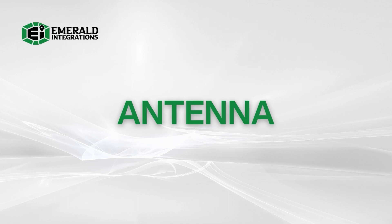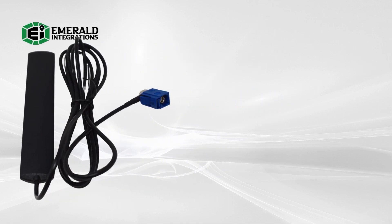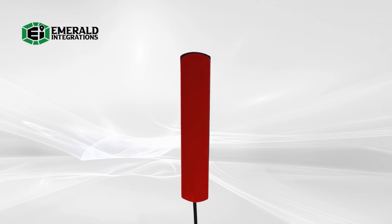For a wireless connection, you'll need to connect the provided Wi-Fi Bluetooth antenna. The plug end connects to the blue port marked ANT on the provided module. Then peel away the orange plastic film on the back side and stick the antenna to a plastic surface inside the dash. Be sure not to stick it to anything metal in order to avoid any static or interference.